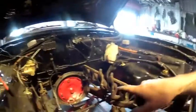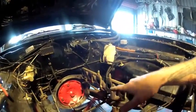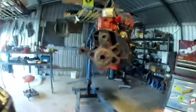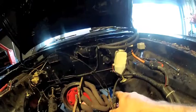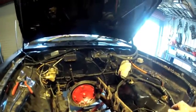Voila! I know that's dodgy, but yeah, it holds it. Sets that out. New one in, I just marked that torque converter so I know when I put the plate back on which holes line up. Whenever you're getting your exhaust made, make sure you get them to put a flange down the bottom so you can take the damn extractors out when you're doing this kind of stuff.